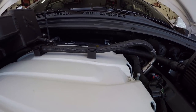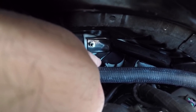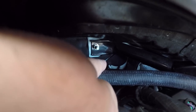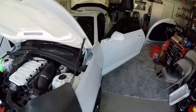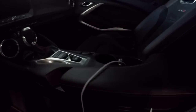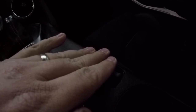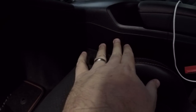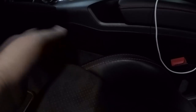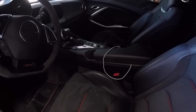One of the fastest ways to get a wire into your vehicle is through the sound tube hole. I got rid of my sound tube but you can see it right here — there's a cap over it. I'm going to run a wire through there, pull it through the car, and get it to my cigarette lighter. I disconnected the negative terminal, so if you're going to do this, roll down your windows first — because if you have no connection, your windows can't roll down. These side panels here pull right off; they're just clipped in place so it's not too difficult to get them off.